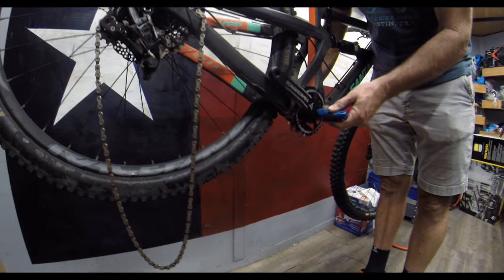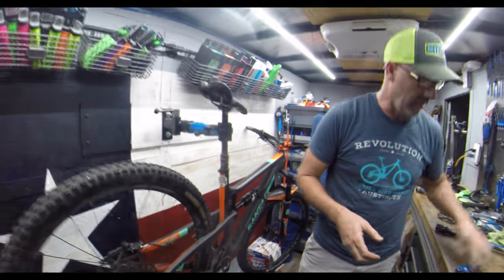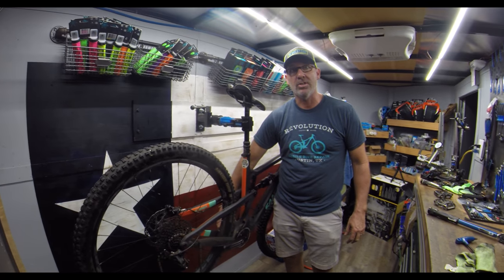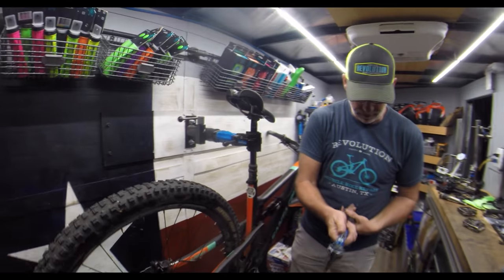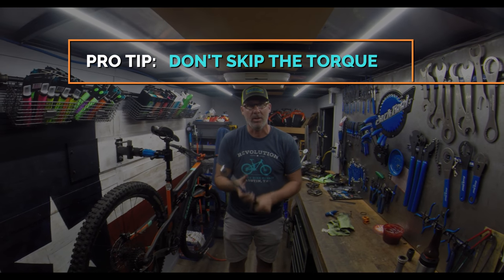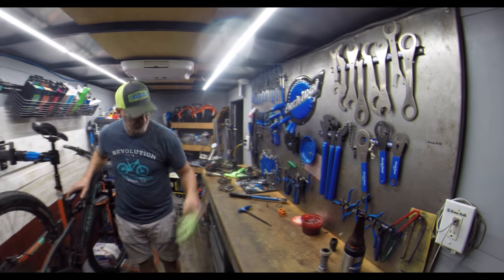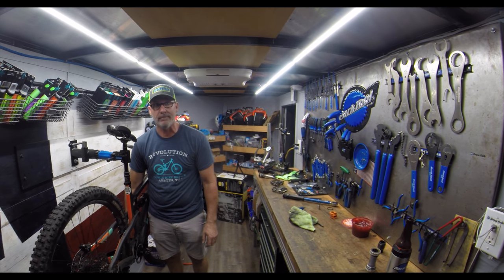Now we've got it set on and I'm just going to hand tighten this because ultimately I want the torque wrench to do its job. We want to make sure we've got this little tension ring all the way to the side — per instructions on the crank, I'm at 50 Newton meters. I was surprised putting on a rotor before — I was like, five, that's not much at all. That's the fun thing about torque wrenches: it takes all the guesswork out of everything and you won't make mistakes. After I got that torque wrench I thought, oh my god, what have I already over-torqued on my bike?